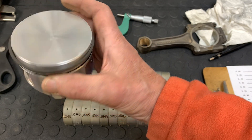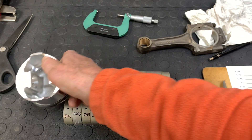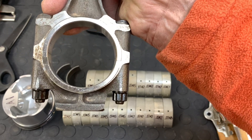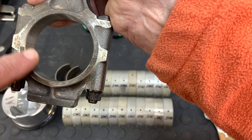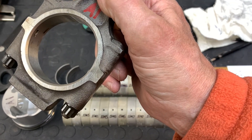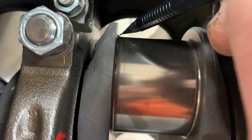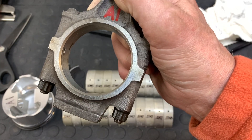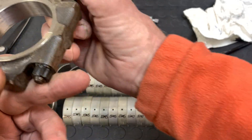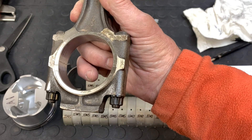So this has to go forward. Now this one is A1, cylinder A1, which is on the right side of the front. When you put that connecting rod in, there's a certain way that this connecting rod has to go. You'll see that on one side it has very little bevel on the inside; on the other, it has a lot. This is really important. Because if you look at the crankshaft, there are radii between the crank pin and the cheeks of the crank, and those are to prevent one gigantic stress riser — it smooths out between the two parts at that point. You have to compensate for that radius by putting that bevel in there. If you put it in the wrong way, that connecting rod is going to jam against the crankshaft and you won't even get it turned over once you've installed it.